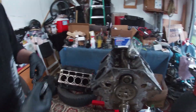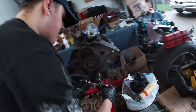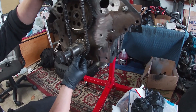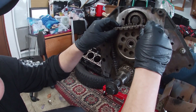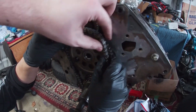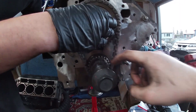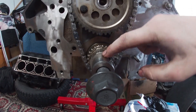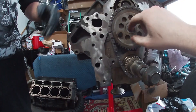We've actually never put a single chain on these back on there. The magnet — hold on to it because there's enough slack. Oh, it's on! The cam's actually not in a bad spot. So basically, you rotate the engine until piston one is at the top, you'll see the dot on the crank gear and the dot on the cam gear — that's top dead center, perfect timing.